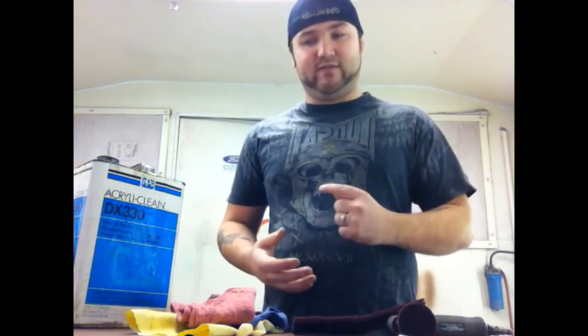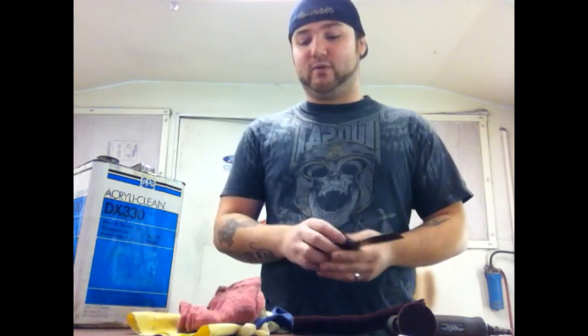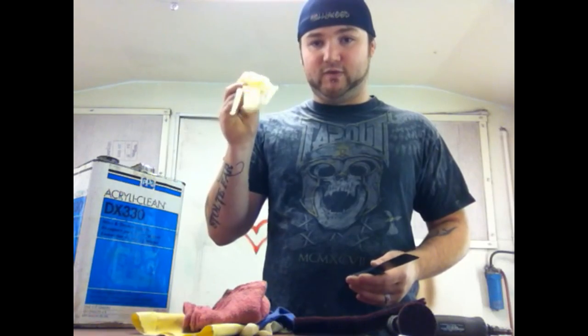The area you're going to want to clean is about two to three inches. The reason is if tar gets in your weld you're screwed, so you want a good area and good distance. The heat from welding gives you good assurance it won't get in. I always suggest two to three inches because if you only clean an inch and it gets in your weld — it may be a month, it may be a year — but at some point it's going to come back and bite you. Remember: always use your PPE, keep your gloves on, keep the chemicals off you.